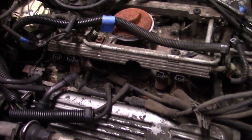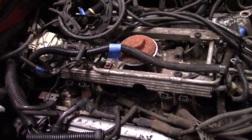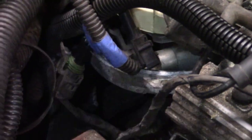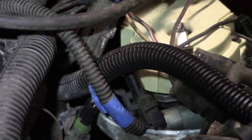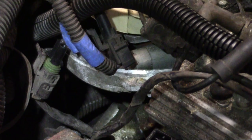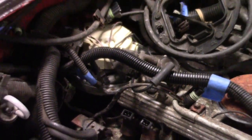And the air pump is still there, but I think I can leave it in place and still clear things to bring it out. My biggest challenge probably is that if you look down in this corner, there are wiring harness bundles between the distributor and the firewall or front of dash section. And I'm still working to clear those out because I'd like to be able to reach down in there and disconnect some of the bell housing bolts.